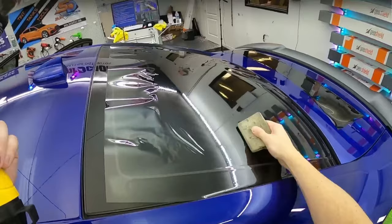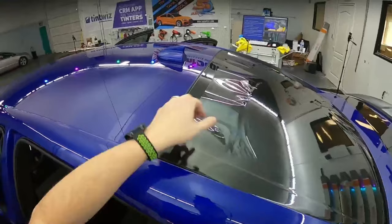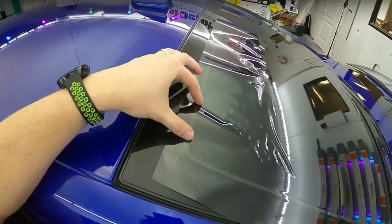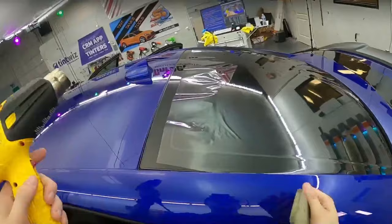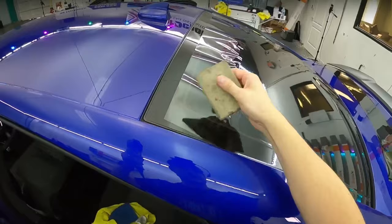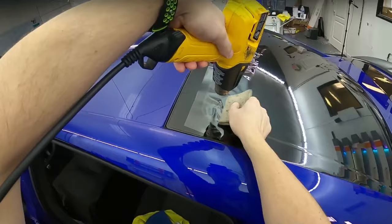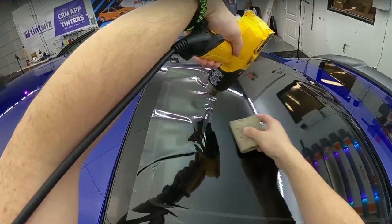So like we discussed before, in corners, things start to get bunched up, so you don't want to keep your film just smacked down like this and try and shrink it all up here, or else you will create a pinch point right here. So I picked it up, I'm letting it float, and I'm just going to kind of shrink this whole section up here. See this little swoop here? See how it's angled here? It means it wants to kind of go out this way. So then just kind of take it up and out. Don't work yourself into a corner.